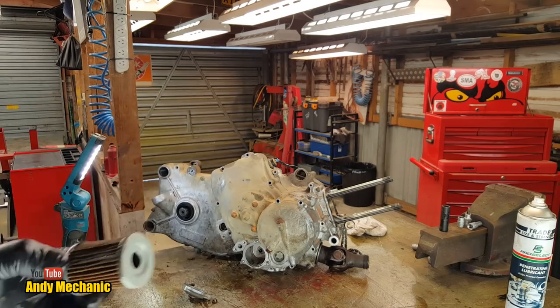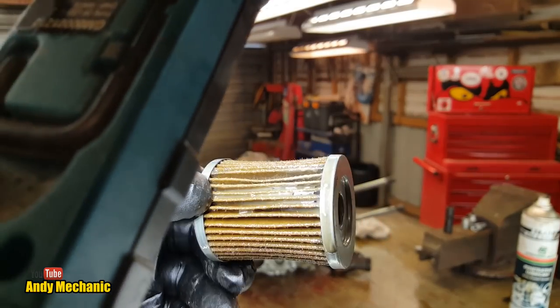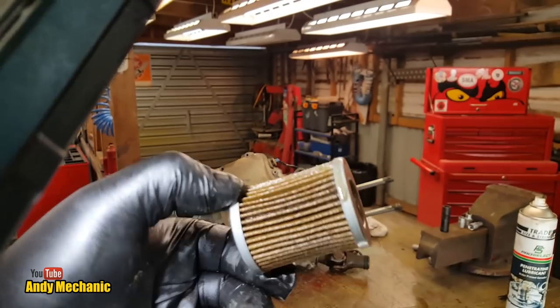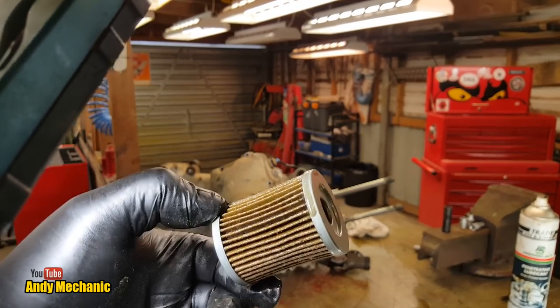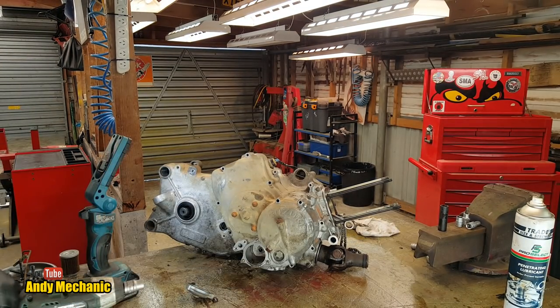Where's the torch? We've got emulsified oil in the filter. All grey and gloopy. I think there's more to it than what this customer's been saying. Now, magic hammer again. See if we can crack this cover off.